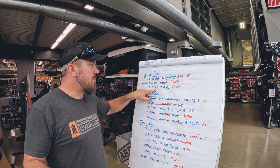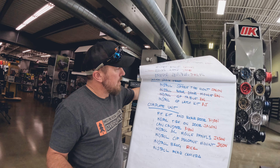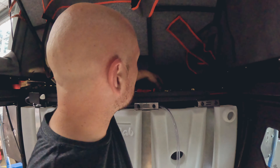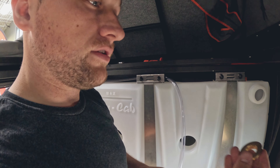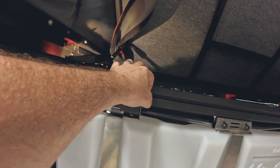I'm just about done with the Butyl and the SikaFlex — about ready to cross that one off. AJ has run power, battery, table slide, awning, and a shower cube, which will go on after we get the camper loaded. They're looking good. When you install a water tank, make sure you tighten the air nozzle — if not, you'll be fishing it out from the bottom like I just did. This is the new version of the vent — the last one was a large box, but this will be really nice.